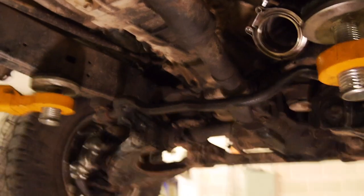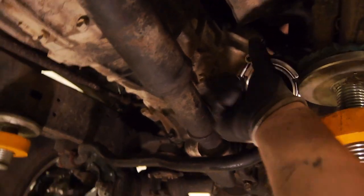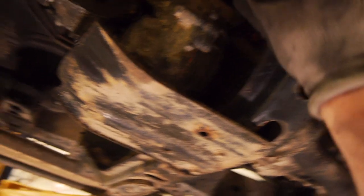So I guess next up, I'm just going to bring this down and kind of out through this opening here, so it'll run up tight there, and it'll go across under the tail shaft and then out this way. Put a muffler up in here somewhere, and then basically just a little bit of a straight pipe out the back with the old 90-degree dump, and that's us.